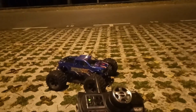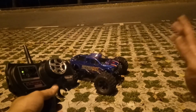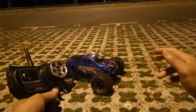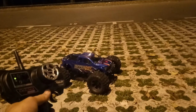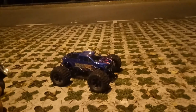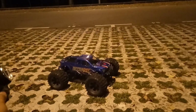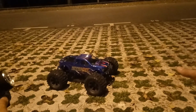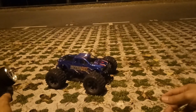Okay, so the suspension tuning, you have the front shocks coming up to the outside, to the top mount on the outside. Reduce the preload on the front, increase the preload on the rear, and that's pretty much it. A little bit more toe out on the front, a little bit less toe in on the rear, because the toe in on the rear of this truck was too aggressive. So less toe in on the rear, more toe out on the front, almost maximum preload on the rear, very little preload on the front, and I'll just put it up in the description.